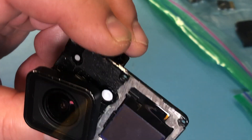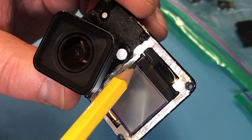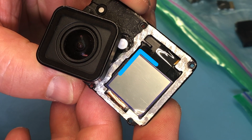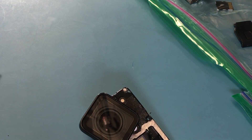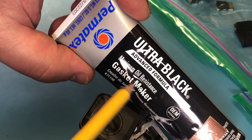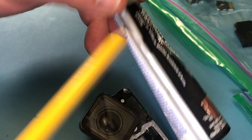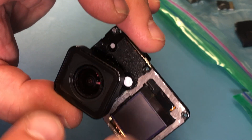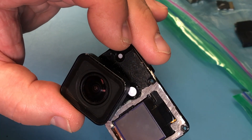On the old one, we know that it was glued on in this area here, down here, here and here. So how did I glue this in? What glue did I use? I had my oil pan gasket replaced recently. This is a Permatex silicone-based gasket maker — a silicone glue kind of thing. That's what I used. It cures within 24 hours and after 24 hours this thing is in place, probably safer than it was before. If we want to get this out again it will break, but there is no reason for it to ever come out unless it's broken.